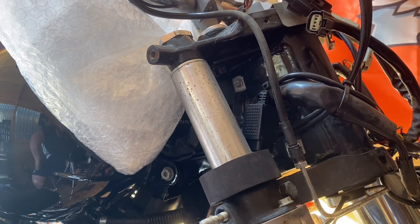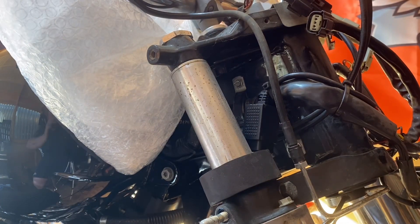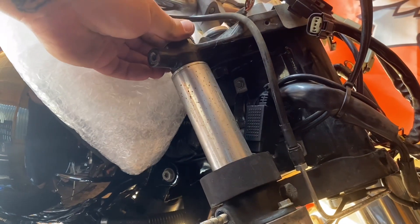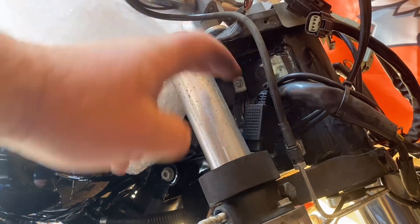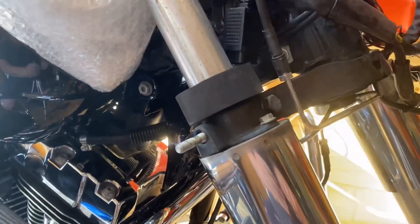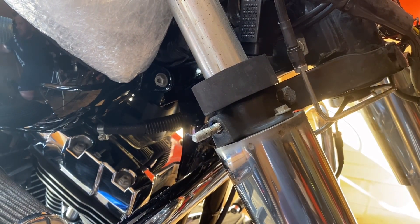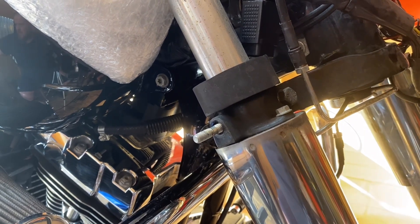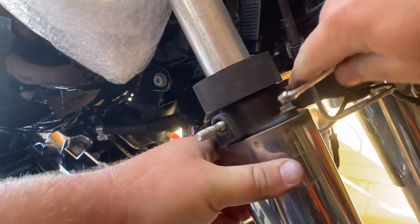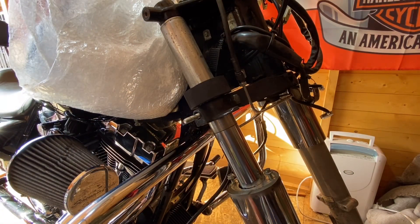I think it's a one and three-quarter inch or one and three-eighths socket needed. I had to order another one and the postman hadn't been yet. Using a 12-inch crescent wrench for now as I've already cracked these. Get some rags ready because obviously there's a hole that goes straight through to your oil. These are three-eighths bolts just holding the fender so we can slide it off. Three-eighths — take these out. The fork caps are off.